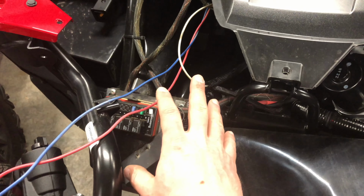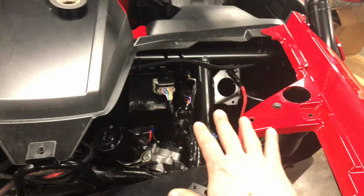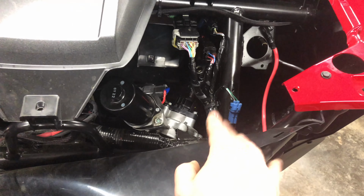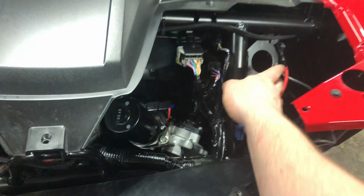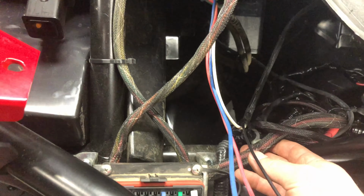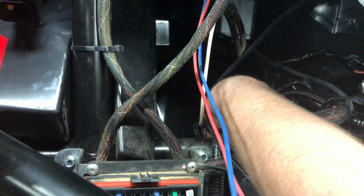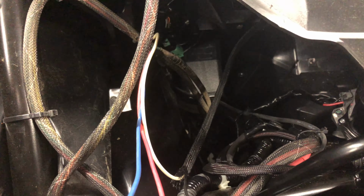Update on day 2 of wiring progress. I've kept the fuse box in the same place, and then instead of doing the positive distribution bar over here and ground and everything, I went ahead and moved it to the back. So these are the factory winch wires. Those are hot now. And then this right here, I just got the excess run, and that ground is going, I'll show you where that's going to the frame. And then everything is relatively neatly run through the tunnel.